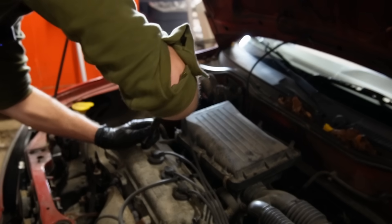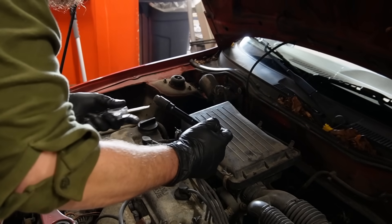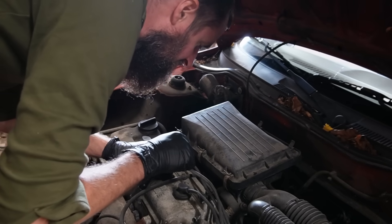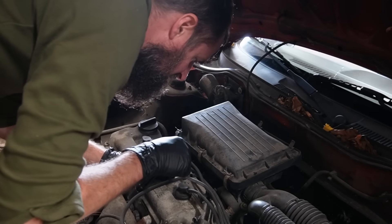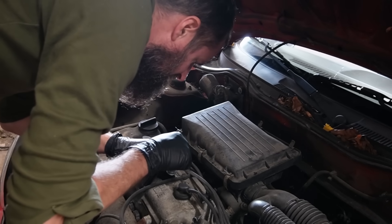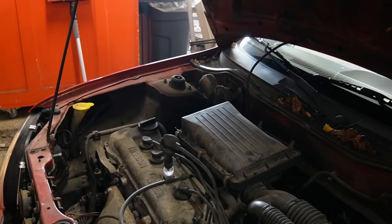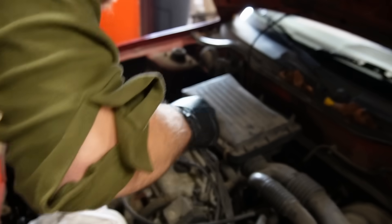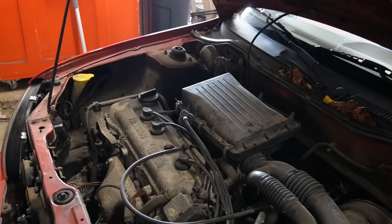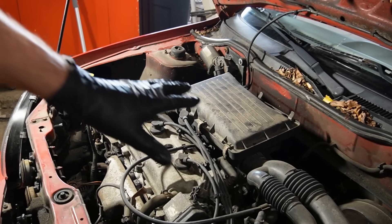It's just starting, which is really weird. It's definitely something wrong. But there was a spark on that one. Currently we don't have a fuel pump engaged, so it started because it was no longer flooded most likely. Could the plugs be fouled completely and flooded? Maybe it's just a matter of removing the plugs, cleaning them up, and then it will run. I should check all of them — yeah, it's sparking also. I think I'm gonna go classic on this and just remove spark plugs and clean them up. That could be the only issue. Sometimes it is basic, and I'm expecting basic on this engine.